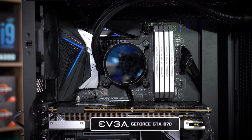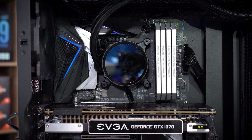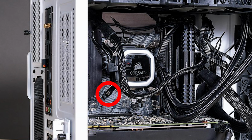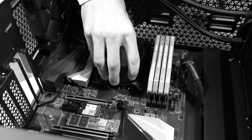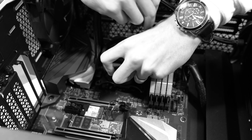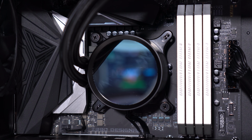To start, we'll run a control and gather temperature data from an ideal model where all 4 screws are tightened firmly and evenly. Then we'll retest by removing the same screw the Verge left off of their build. It's important here that we remove and clean up any thermal paste from the previous run, since the thermal paste needs to redistribute itself with only 3 thumb screws present. And then, just for kicks, we'll repeat the same process once more with only 2 opposing thumb screws tightened down.